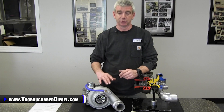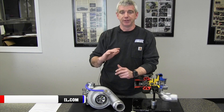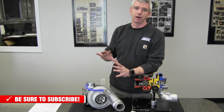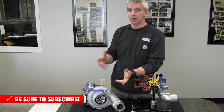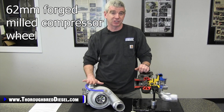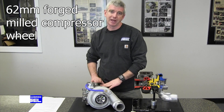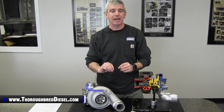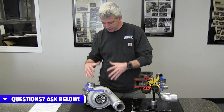I want to talk to you just a little bit about the charger that we actually received. Because Adam's truck has got light fueling upgrades, we requested a 6280 charger — the Fat Shaft 6280 — and that is going to be your best of all three fat shaft series chargers for towing and daily driving. Specs on this charger: this is a 62 millimeter compressor, and the fat shaft lineup has a 65 millimeter turbine wheel. We did this with an 80 AR exhaust housing, so the 14 centimeter exhaust housing. You can also get this in 12 centimeter, which is going to spool up a little bit nicer, but you're really going to have to watch your EGTs with 12 centimeters. We went with 14 centimeter — that's going to be just a little bit laggier than 12 centimeter, but it's going to help us control EGTs really well. Adam does a little bit of towing during the summer, pulling a boat, and with the fueling upgrades we felt the 80 AR was going to be the better choice for him.